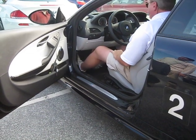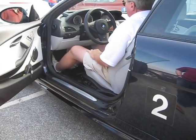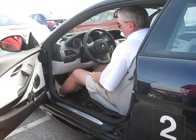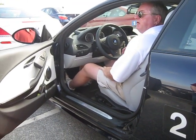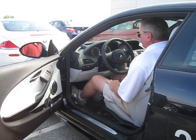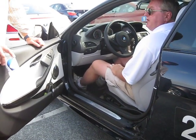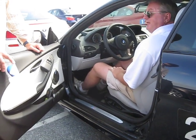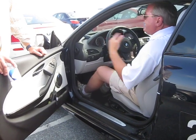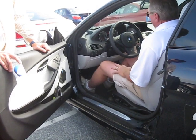Now, everybody familiar with SMG? Everybody not familiar, okay, SMG, sequential manual gearbox. It has a clutch, pressure plate, flywheel, throwout bearing, everything, but no clutch pedal. The shifting is all done electrohydraulically. Quite frankly, guys, when we first started getting SMGs in, I thought, this is no more than a marketing ploy. I can just see it right now: Honey, we can buy this M3 and we can both drive it because you can put it in automatic. And I'm sure that there were some M3s sold that way. But there's a lot more to it.